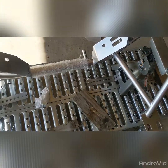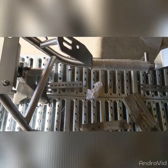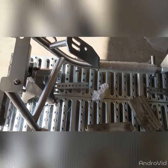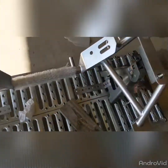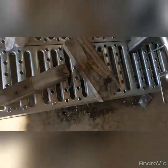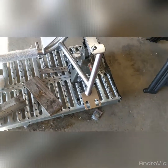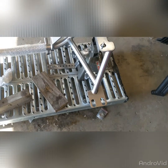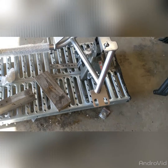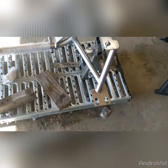You can see how I'm going to hold the jack stands from tilting outward — that's one of my fears, that they're going to want to spit outward. The K-member is kind of pinned from sliding off the jack stands with what I'm calling pogos — there and there. Down here I've decided to use some simple strap iron. Similar technique, but it's just going to come up and bend over, and you'll be able to rotate it in off of one of these points to hold it somewhat in place. I don't even think I need to bolt anything down. The K-member can just rest on top of whatever that is, and when it's time to pull it up it won't be in the way.